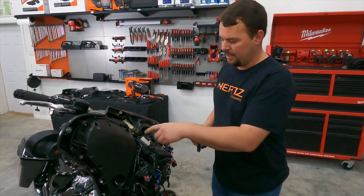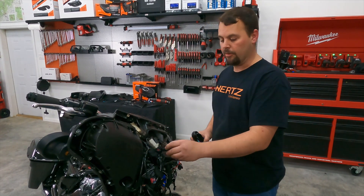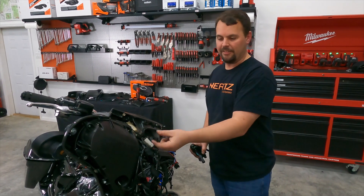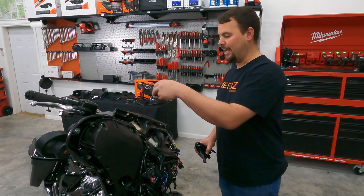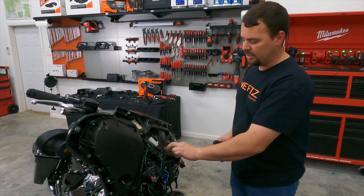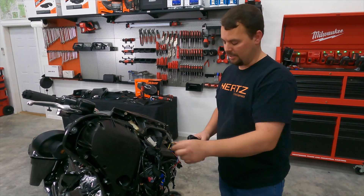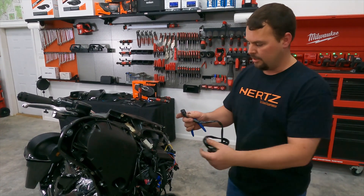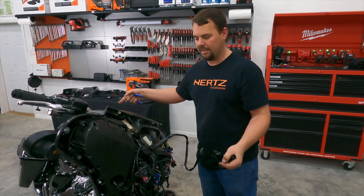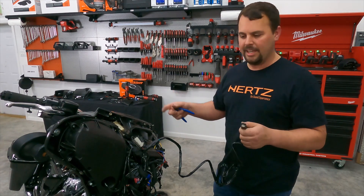All right, so we've got our fairing off. As I mentioned in the last video, there's a harness in the fairing that runs to our rear speakers. All 2014 and newer Harleys already have a rear speaker harness up here — it didn't do anything from the factory. So we flashed the radio, which added a fader on our radio to show that we have rear speakers and made this active. When we had our Hertz HMP 40 amp, we used a T-harness so we didn't have to cut anything, and it tied to this same connector. Now we're going to plug into this connector with our harness, route it down the backbone of the bike, under the seat, reassemble, and then this will be a great place to hook our T-harness up for our bags and our quick disconnects.